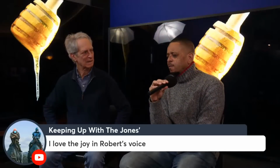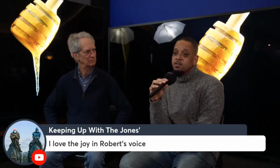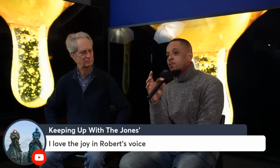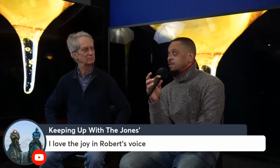The Samsungs, again, the grayscale is easy to calibrate for me. Colors you can't touch. So overall, of course, that means that the Samsung is easier to calibrate because I don't have to mess with CMS. But the CMS on the Sonys I can do in 5 minutes or less. That's how great the control set is on that. Summary is just post-calibration, they're pretty much perfect. As good as you can get on the grayscale. Colors, of course, are better on the Sony.